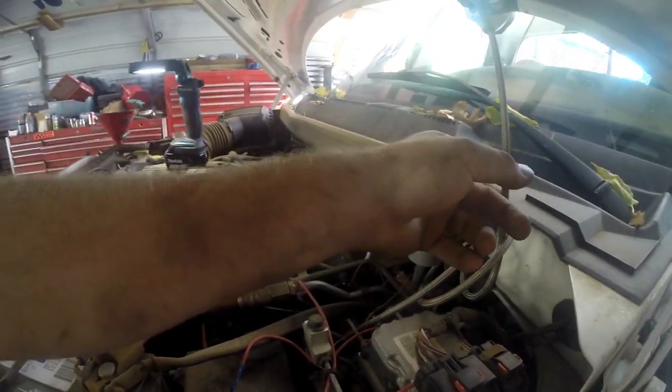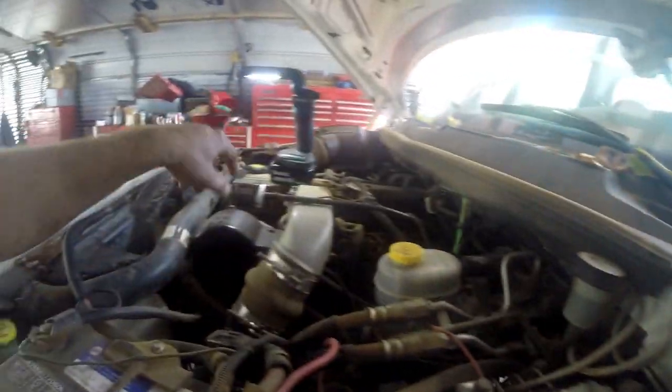It wasn't too many years into my dad owning this truck that the injection pump died. Didn't know what the problem was. Put a new injection pump on it. Come to find out, it was the lift pump that failed, like I was saying. So one thing after another. It's running a FASS 95 on it now. He's got this rigged up so he knows he's running fuel pressure, because if you lose fuel pressure to this, it's dead. It'll last a little while.